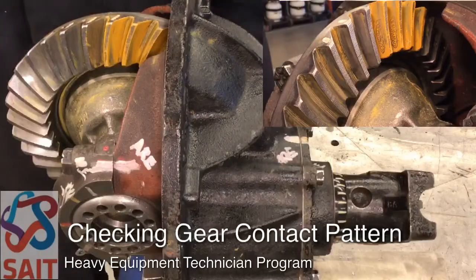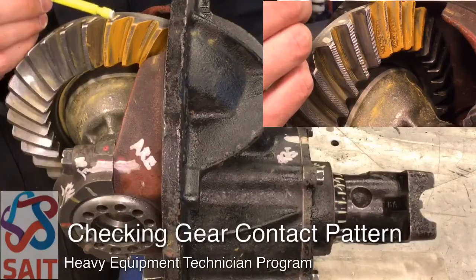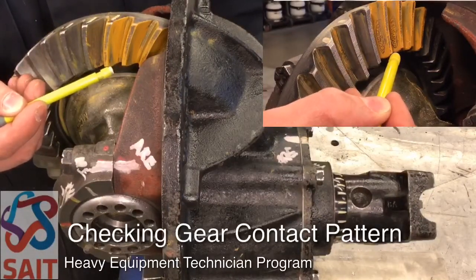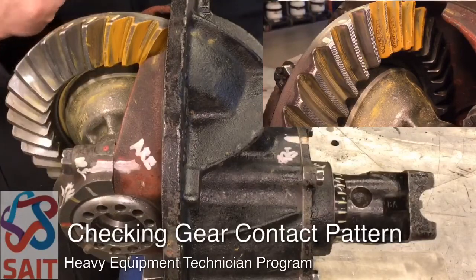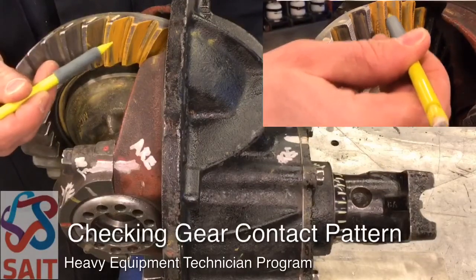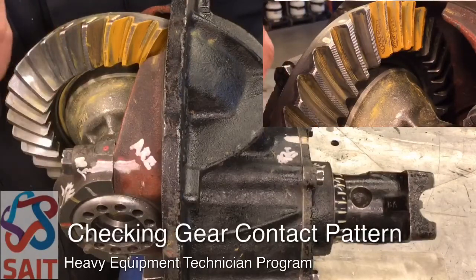Looking at the coast side, it's really close to the toe right here, which is really normal. On our bevel gear to pinion pattern, when the drive side is excessive heel, we often see the coast side is excessive toe. On an automotive or light duty pattern, you'd know you're sitting about right when both drive and coast sides are centered and face and flank is also centered. On heavy duty axles, we expect to see the drive side pattern closer to the toe and the coast side closer to the heel — remembering that commercial vehicles especially spend very little time in reverse.